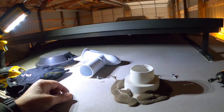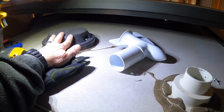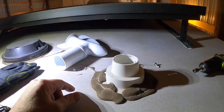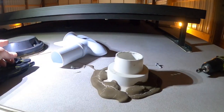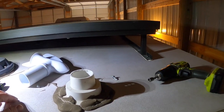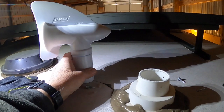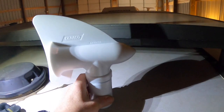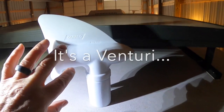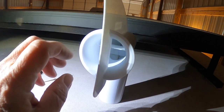If you're still having issues with fumes coming out of the black tank - I'm on the back of the trailer here and my exhaust for the bathroom is about 12 inches away from my black tank vent. There were times before I used the Happy Camper that I'd have fumes literally drawn right into the exhaust fan. To solve that, I came across this years ago - it's kind of like a weathervane-type gadget made by Camco. I'll put the link in the Amazon description. For you engineering types: you have wind flow coming across this bullet shape and it creates a vacuum, pulling a vacuum on your black tank exhaust pipe.